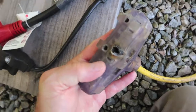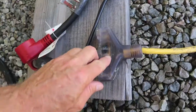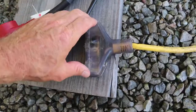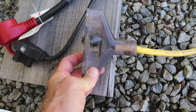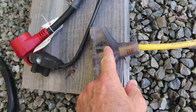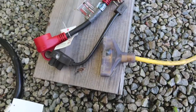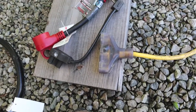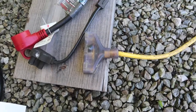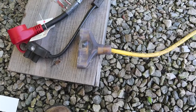The cord will need to be repaired — I'll cut it here and just put in another receptacle on it. It looks like it got so hot it damaged the internal bus. You can see that copper bus running in there if the sun hits it just right — we got it pretty hot right there too. Your biggest issue when you start heating up like that is voltage drop. That AC can't stand too much voltage drop without damaging the motor. I can only hope I didn't damage mine — it's a brand new unit — but time will tell.